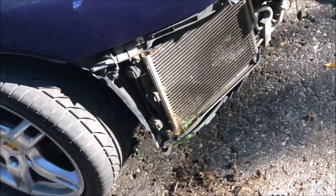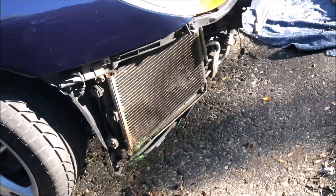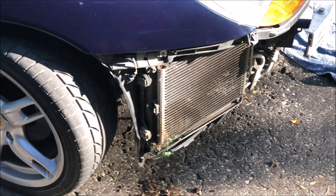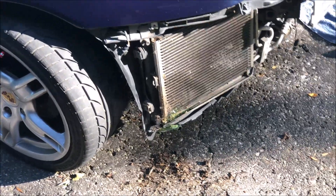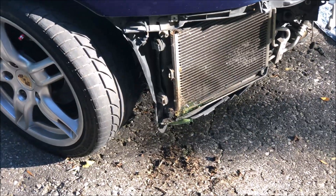What I'm worried about right now, I just wanted to find the leak—and that is the leak. So I'm going to shut off my car and the compressor to keep from compressing nothing. Oddly enough, the compressor on the Boxster comes on whether or not... I guess there's no pressure switch in line in these. There should be an AC compressor pressure switch to allow the compressor to turn on, but apparently this one doesn't have one.